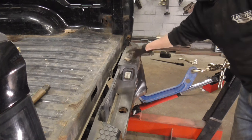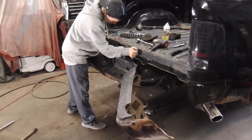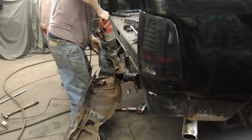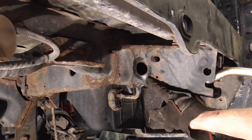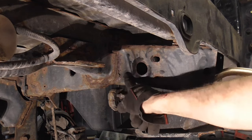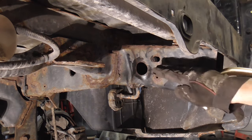At this point we'll remove the bumper and then start pulling the frame rail. After pulling the bumper, we're now going to try to straighten the frame rail. You can see that little kink right there and right here. We'll try to pull up on an angle and then pound down on the bedside, and hopefully that straightens that out a bit.